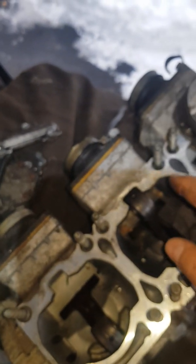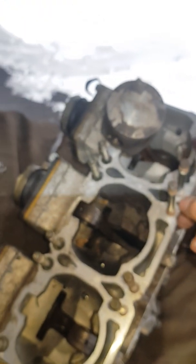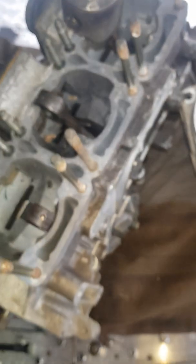Another thing I do before I fire it up, since it might be starved of gas, is I get a bottle that sprays in a little bit of gas — I just put a little bit of gas in each cylinder to help prime it. And before doing that, do a compression test. Hopefully everything will work just fine and it'll fire up. Next video will be on how to do the crank.